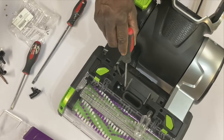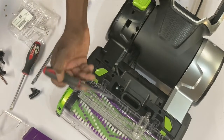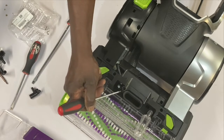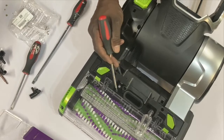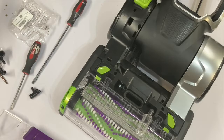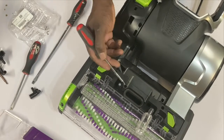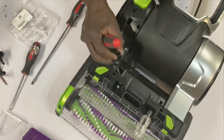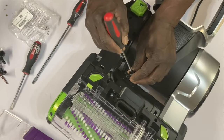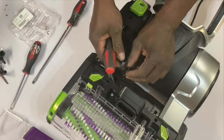So, to avoid this problem, guys, what I think happened is the person that was cleaning this out, maybe some debris, pushed too hard down, did not realize this was a very delicate film right here. Very delicate stopper, okay? So be careful when you are trying to get lint out of here. Or if someone tells you to prime the pump or something like that, and they tell you to push down in there, because you can destroy this thing, and that's what happened with this. That film that's right here, it's busted, all right? And then the water's just oozing out, okay?